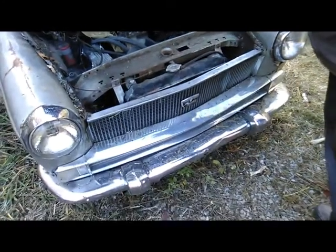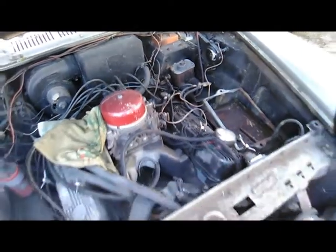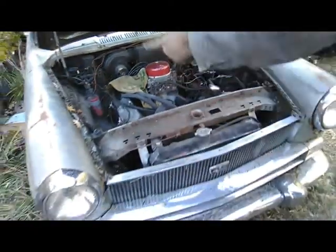And it's got the old GMC dual master cylinder back here. It does your clutch and your brakes, which is what I've got on my chopped Plymouth too. Wow. And then just the old Dodge electronic ignition, like everyone puts on Mopars. And I had to make those headers too, make them fit.